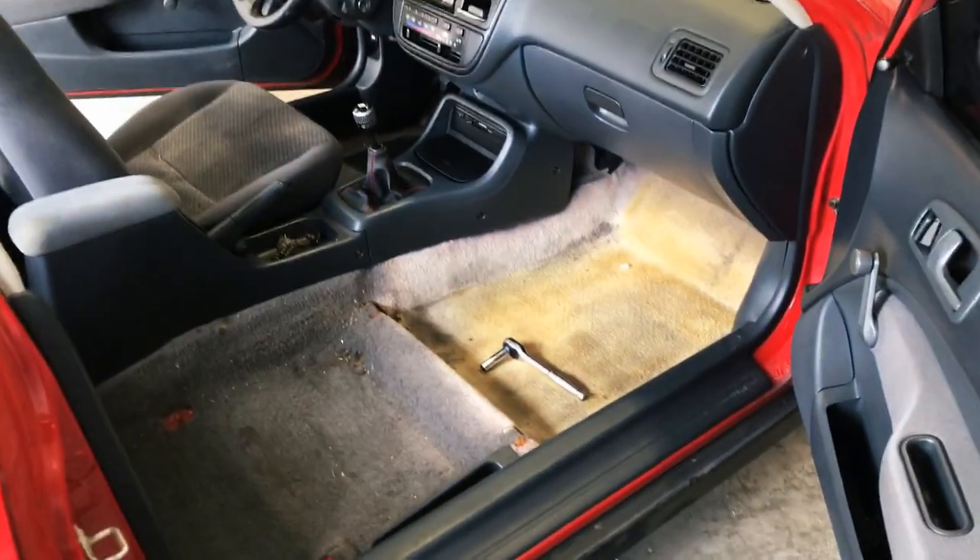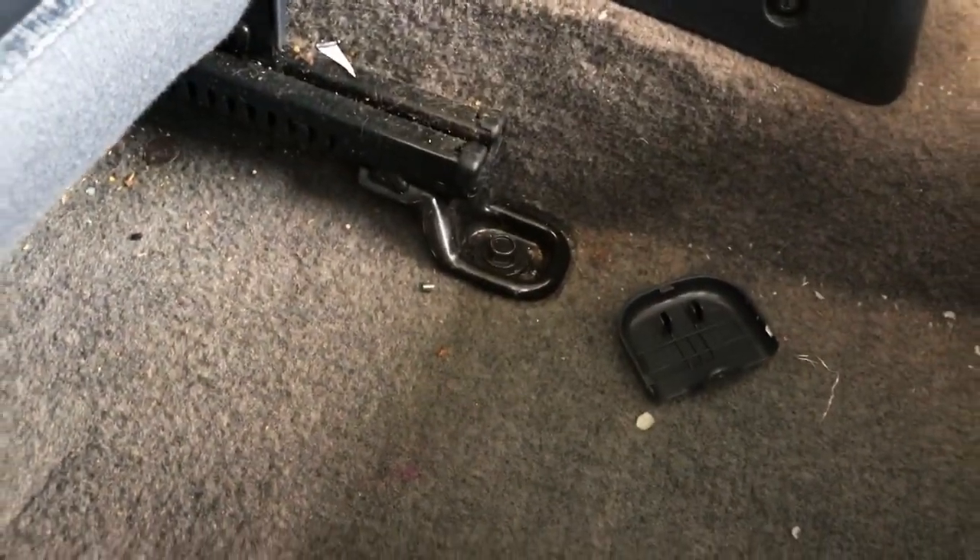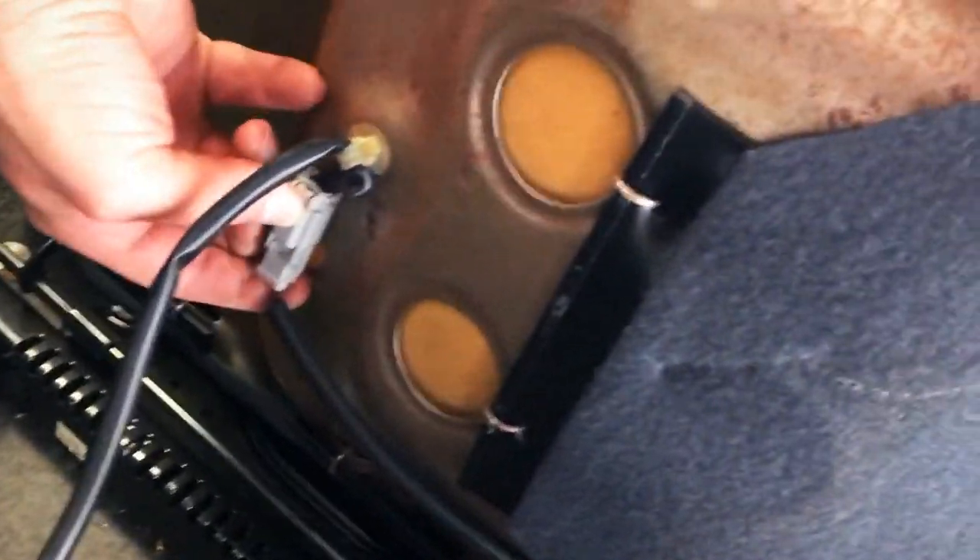So real happy we're going to be addressing that. Just a quick note: on the back of each seat, you should have this little kick plate that you've got to pop off with a little screwdriver. Then it has the bolts underneath it. I just remembered that I took my passenger seat out before, so that's why I never replaced that one. Then underneath this seat here, we have this little clip — I believe that's a seat belt sensor.